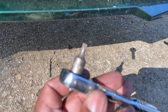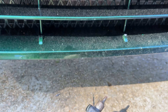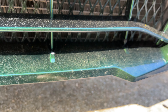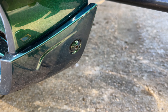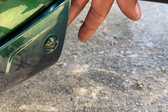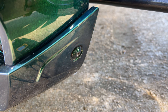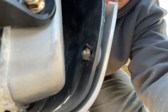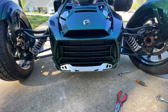What you'll need is a T25 bit — that's how you're gonna get the two screws loose. You can see how the screws are made right here. For the screws on the side, on the inside there's a nut, and that nut is just gonna keep spinning on you. So you're gonna have to get something to hold it from spinning. That's the nut on the inside right there — you got to get something on that to hold it so you can get the screw loose.